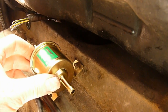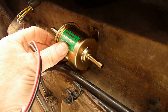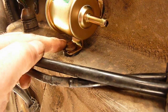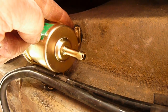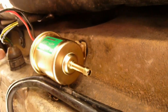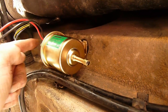There's a 10mm stud located exactly where the pump would be ideally suited. So we're going to make use of this. I've now bent the tube and the two brackets, and it marries up nicely in the corner. The pump is now secure — we used a self-tapping bolt in the bottom hole and a 10mm nut on the stud that was sticking out, so fortunately nothing needed to be drilled. We need to cut this pipe now and join the pipes to the pump.